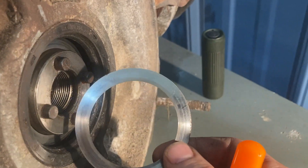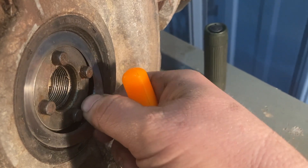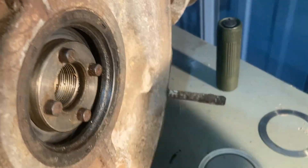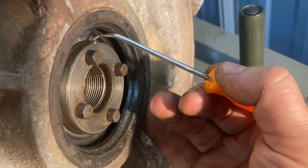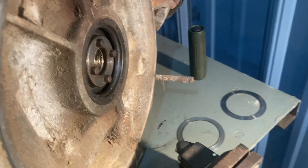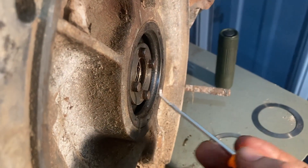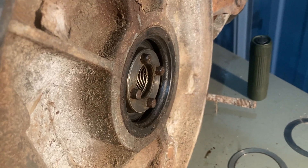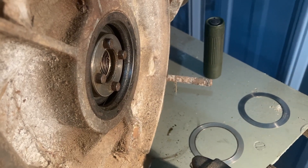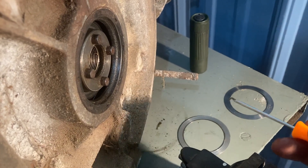If you run your 1600 shim with the 1600 12-volt flywheel on the 40 horse crank after machining, what you're going to do is get it up into there, it'll come up and seat against the step, and then when you torque down the gland nut it's going to roll the inside diameter of this shim up over and mangle everything in there - your engine is going to be ruined. So as we've seen in this video, you can run a 12-volt 200-millimeter flywheel on an earlier 6-volt stepped style crank as shown in this 40 horse. However, you must machine out the flywheel to make it fit over the stepped part of the crankshaft, and you must use the old style shim that's made for this crank.